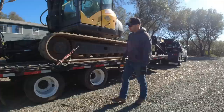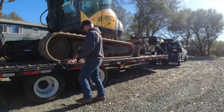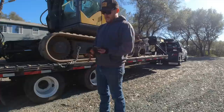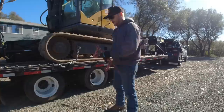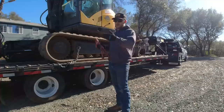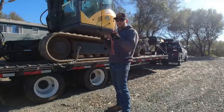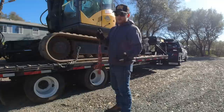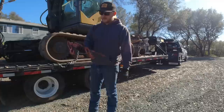And if you're doing this day in and day out on multiple trips a day, you don't want to be doing that. So I think these snap binders are pretty much a thing of the past, except for on logging trucks. Why logging trucks? Because when you chain down your load, you throw a binder strap over the whole top of the load, and the binder or the chain will actually dig in with the tension. You'll have to go down the road if the load is shifting and readdress it, but you can actually hump on these a little bit. With wood it's forgiving and it'll fall into it. So one of these actually works pretty dang well for a logging truck - this is actually where it came from. This is off a logging truck - it fell off or got left at a job site and I picked it up.